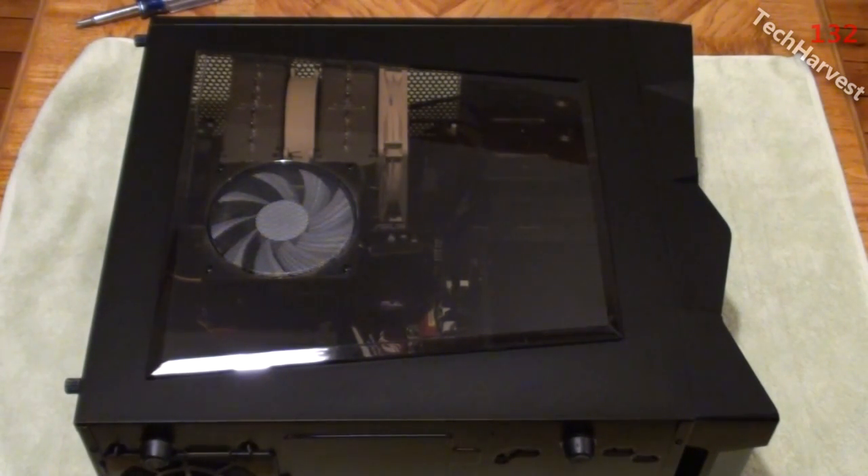In this series of videos upgrading my PC build, I'm going to install a Sony multi-card reader and writer. If you've been paying attention to my channel, you saw the unboxing of this back in October. Because this case only has 5.25-inch drive bays in the front, the card reader wouldn't fit — it requires a 3.5-inch drive bay. You can get bracket converters for that, which I've done, but I just haven't had the time to install it until now.